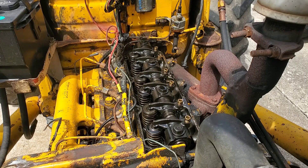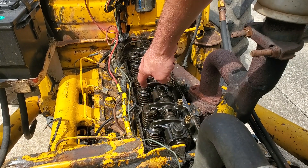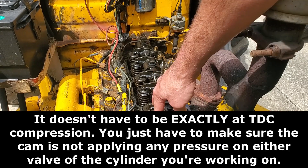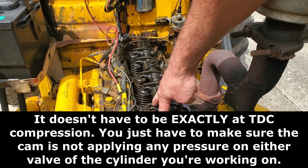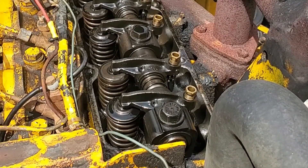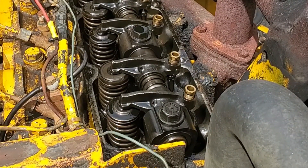What we're going to look for to start with is both valves moving. This is your intake and this is your exhaust. The front valves are your intake valves; your rear ones are the exhaust. So what we're going to look for is the exhaust valve opening and then the intake valve opening. Once they both move, we're going to rotate it another 360 degrees, because then we'll be on compression stroke. There are timing marks on the flywheel, but I like to do it this way just so we can verify that we are in fact on top dead center compression. Right there — cylinder one, both valves are moving.